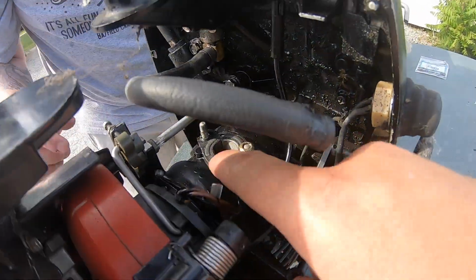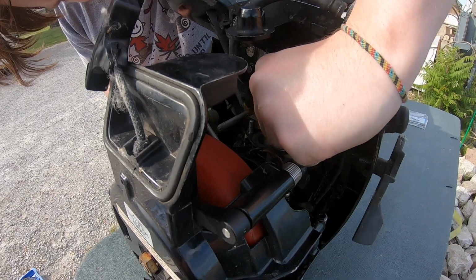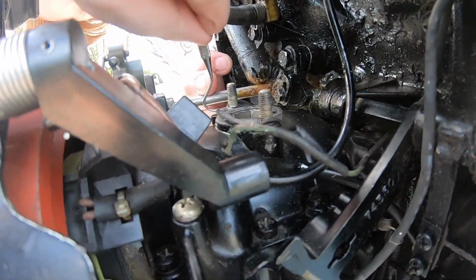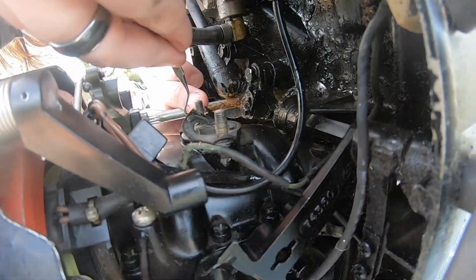All right, so there's still the old gasket right here. We're gonna be very careful to take it off without it falling in the hole. We could stuff a rag in the hole if you're uncomfortable. Let's see how it works though. It's molded right into the machine. A carburetor's job is to meter the air and fuel coming in. So if that thing is bad and a little bit of extra air gets in, then the carburetor's completely defeated.